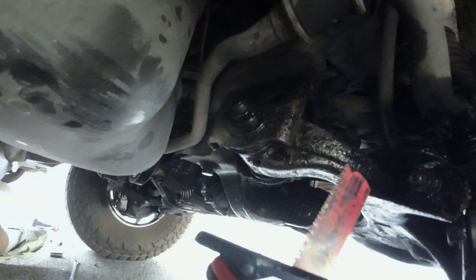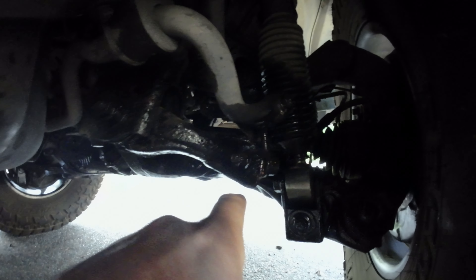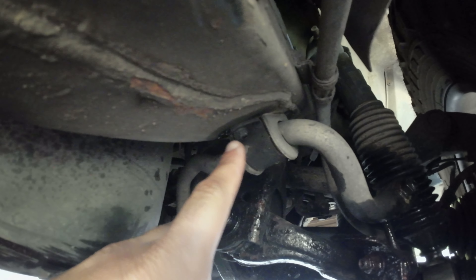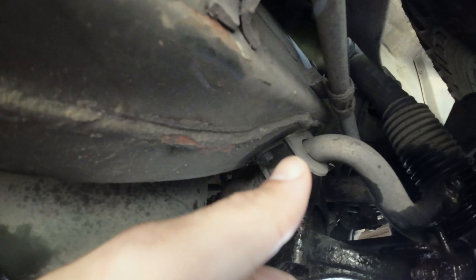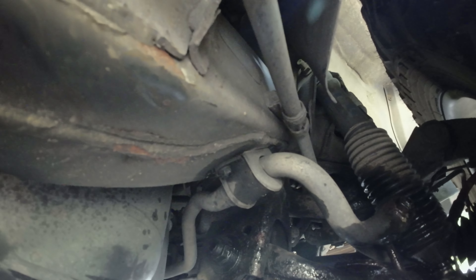My trick to get it off is either a reciprocating saw on the back of the end link, or get one of those vibrating saws that buzz and you can just buzz the head of the bit off. Odds are the end links on your Sequoia, if it's as old as ours, are going to be rusted — so just be careful, these might seize up. Another thing that might seize up are the bolts holding the sway bar brackets to the frame. While I did coat these in fluid film last night, there is rust that gets into the frame and makes those bolts difficult to remove. It's very easy to snap these — they're just 12 mil bolts and you could literally just snap them off in the frame, and then you're not left with many options to bolt the sway bar back in.